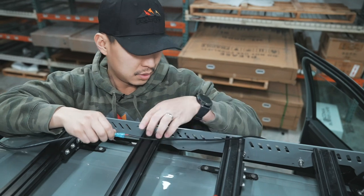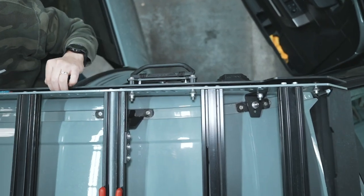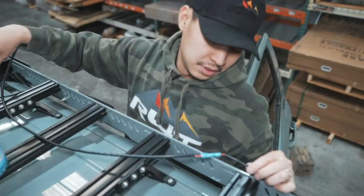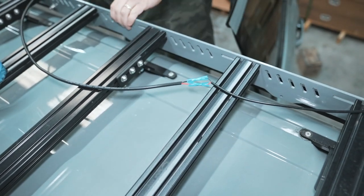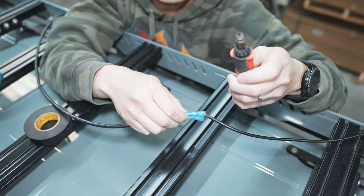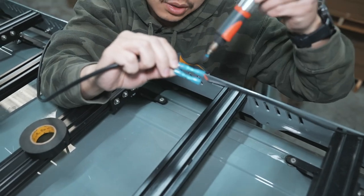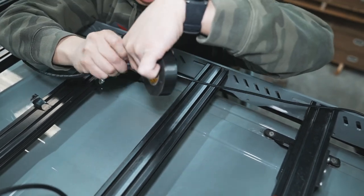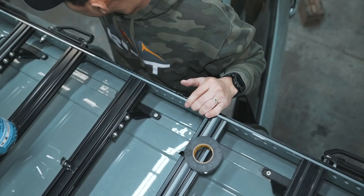Since this is an Alpha rack we do have two side plates here. We're just going to set the wire in between the inner and outer plate on top of the spacer, and run it all the way to the back one. Since it's going to be in between two plates, we're going to heat-shrink and electrical-tape it up right now — be careful not to melt your wire — then run it back.